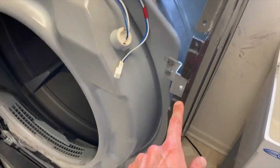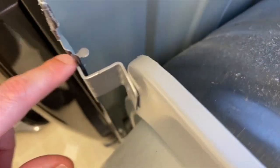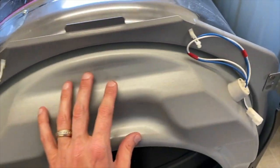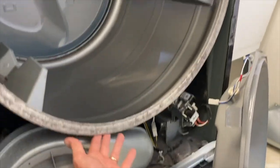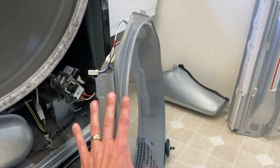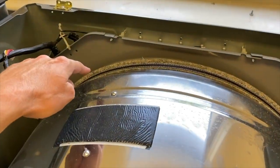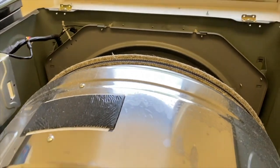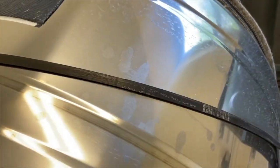Back up top, you've got four mounting screws that hold this entire portion in place — two on each side. Remove those. As you lift this portion up you can remove it from its little slot — grab it with both hands so you don't drop it. The drum rests on rollers on the back side, so as you pull this part away, your drum will fall slightly. Then put your entire arm in, lift up, and carefully pull the entire drum out of the dryer. Be very careful not to let that belt catch on anything.